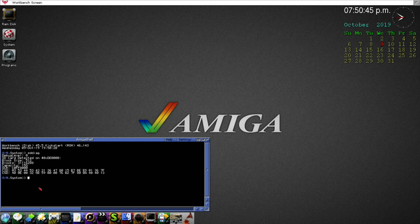If you get an error, try cleaning the contacts on the card and in the SD card slot. If you still get errors, you probably need a different SD card — it may not be compatible with the Vampire. With Kingston drives, they show up fine in SD diag, but if I use the Professional File System instead of FAT95, I get lots of write errors and other weird issues. I highly recommend using SanDisk models — they seem very compatible and compliant.